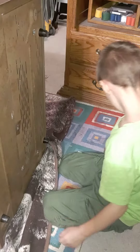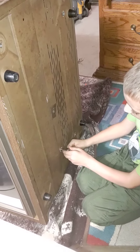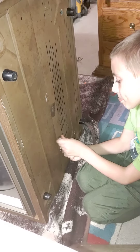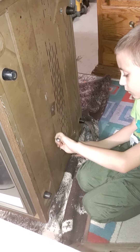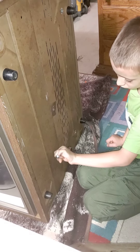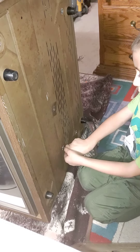Now, when it gets to the very last screw, you're probably going to have to take it out with the wrench all by yourself because it's going to be pulling to try to fall down. One thing you want to make sure when you've got a socket is that the socket is seated flat on there, because if you turn the socket with it sitting crooked, it'll shear off the top of that head and you won't be able to get the screw out because there'll be nothing to grab onto.